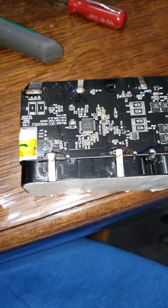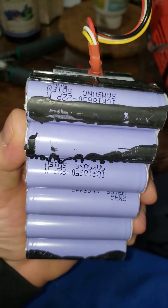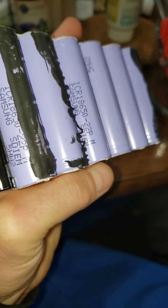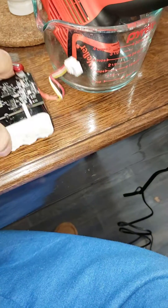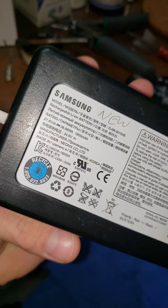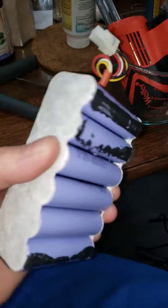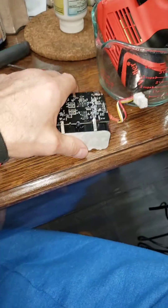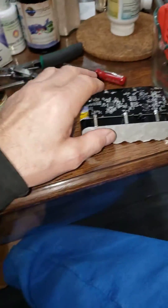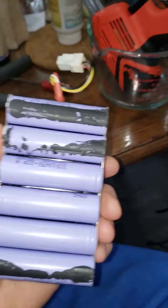There's a circuit board that controls the charging on them and a whole lot of other things. And then there are the lithium-ion 18650s in them. The 1800 mAh have six batteries; the 3600 for the larger capacity batteries, which are not interchangeable between models. So the 7040 has the smaller battery, the 7050 and the higher models in the 7000 series have the double capacity batteries.